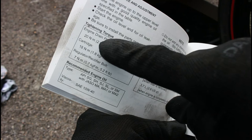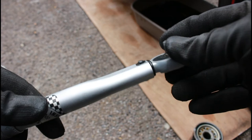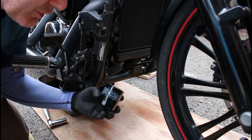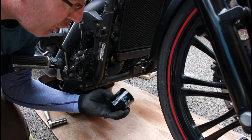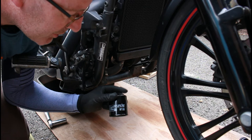This is my torque wrench — a smaller one for lower torque settings. I've set this to 20 newton metres. Now for the filter: this is an HF303 High Flow filter. Coincidentally, the filter that came off the bike was also an HF303 — not a coincidence really, the 303 is just the correct type made by this company to fit this machine and various others. This particular one fits the VN900 Custom.